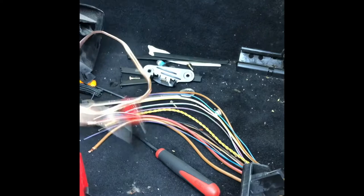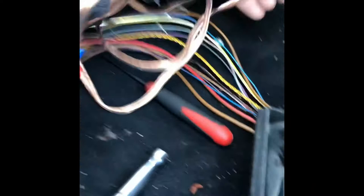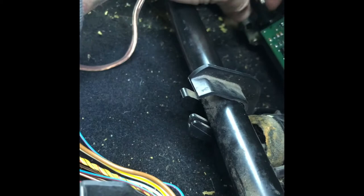What I'm using to do this is a very simple homemade jumper system — I put a couple of spade connectors on the end of a Milwaukee 12-volt battery and plug those in. This will now give you power through alligator clips or whatever type of connection you really want on here.